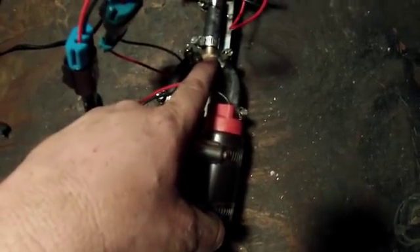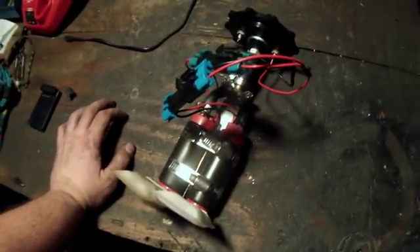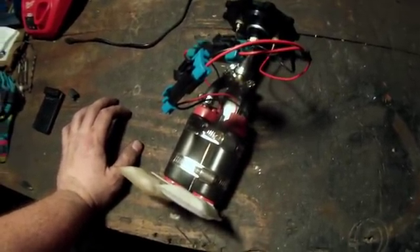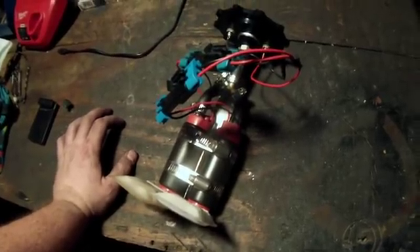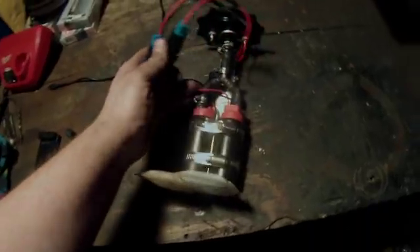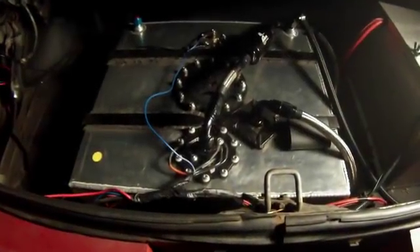This is all I could get really quickly that'll fit in here without a long lead time, so we're going to go ahead and get this back in. This weekend we're going to try it on the track and might do a little tuning first, because obviously with more pressure it's going to run a little bit richer. So that's how you do the dual fuel pump setup.